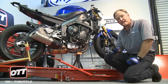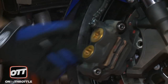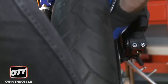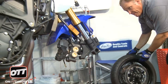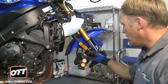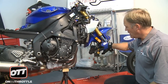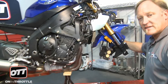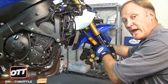Our first job: remove the brake calipers and then remove the front wheel. Now you're going to remove the fender. There are two allen bolts here, but this reflector is also part of this — you're gonna have to be very careful when you remove this particular one. Also on the backside of this bolt is a 10 millimeter nut, so just hold it with your hand.